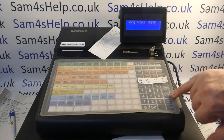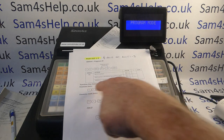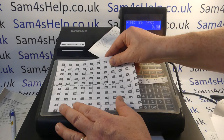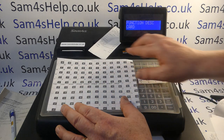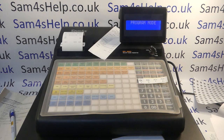I'm also going to quickly show you how to change the charge 1 button name to 'card'. As standard the button says 'charge one' — I've never got to the bottom of why, it must be an international terminology thing. It's the same process — function key descriptor, program mode, 80, subtotal, type 'card', press quantity/time to save, press the button you're giving that description to, then press cash. There's a separate process for changing the 'card in drawer' label on the financial report which I'll show you separately.